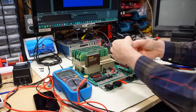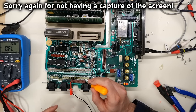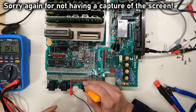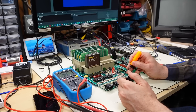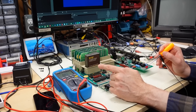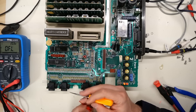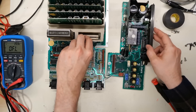I'm going to do a quick Google for 'Atari 800 keyboard matrix.' Here it is — Atari 800XL, not sure if that's the same thing. As you can see in this matrix, when you push the M key it shorts together pin 7 and pin 12, and that's what makes the computer register that key press. Take a look at this: the POKEY doesn't read the keyboard directly — it goes through these CD4051 ICs here, which is actually potentially a good thing, because these are socketed. If something bad were to happen on the input, those ICs would probably go first before the POKEY does, and those are easily replaced. For testing, I'm just going to clip a clip lead onto pin 1 and short to the other pins — and we should start seeing key presses. There's the nine, and there is the zero that I was expecting. So that tells us right off the bat that we have no problem with the circuitry scanning the keyboard — the problem simply lies in the keyboard itself.